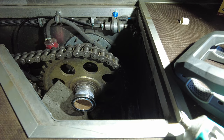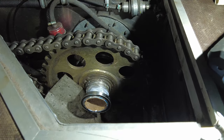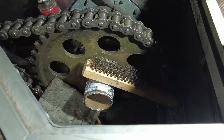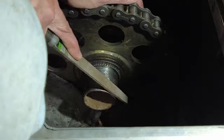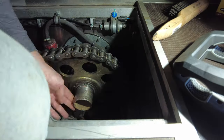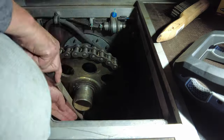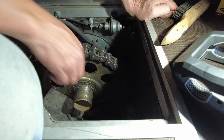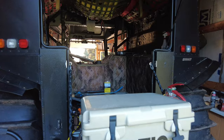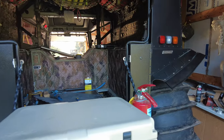Oh, disappointing. I spent so much time sanding, putting on the bearing, putting it off again - it was absolute hell. Last time it was difficult also. So I thought I'd try the dry ice method - I couldn't think of any other way. I used files, brushes, sandpaper. Enough is enough, so we're going to try a new method: using some dry ice. See if I can get that pipe to shrink down a little bit so I can get that bearing on.